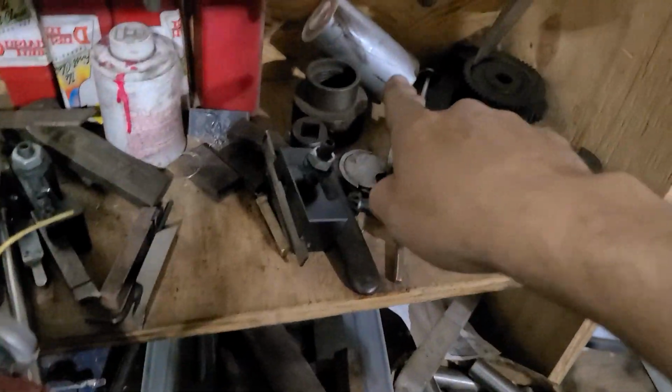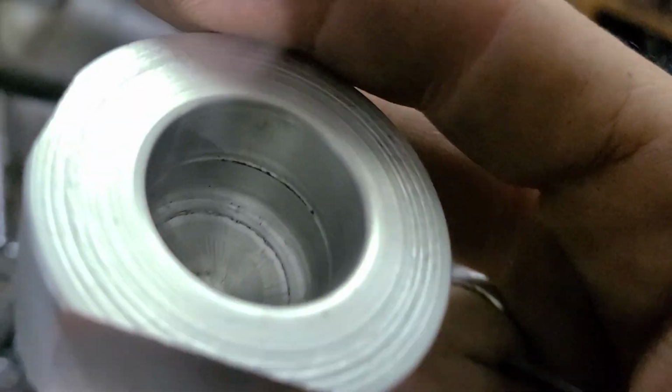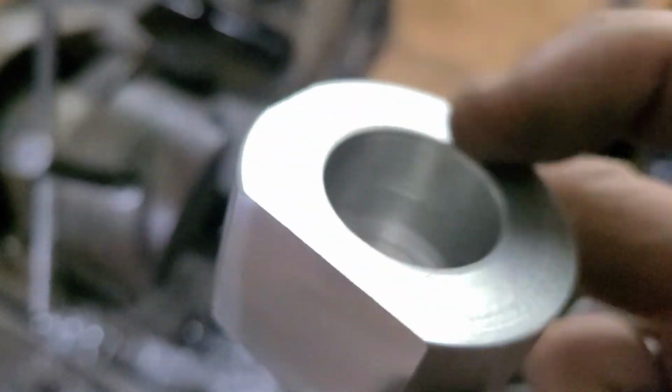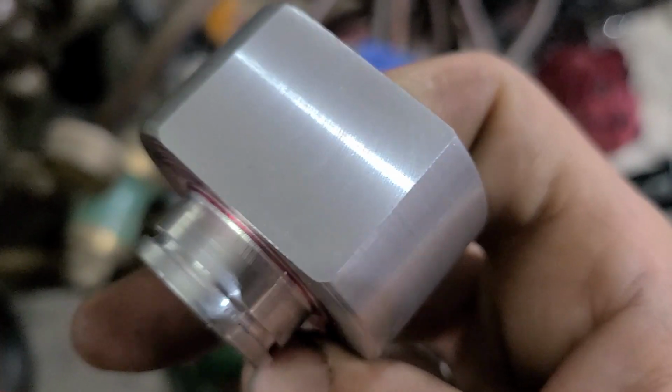So I took just a piece of 2-inch bar stock that I had floating around, cleaned it up a little bit, bored it all out, except I got a step on the bore because it jumped in the jaws. So I got to take that out and fix that. This machined surface really doesn't matter at all. I didn't even do a finishing cleanup pass because it doesn't matter. Although I did there, and that came out nice.